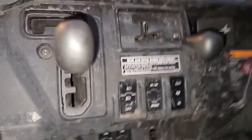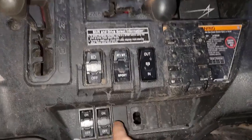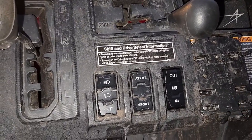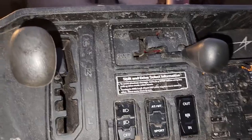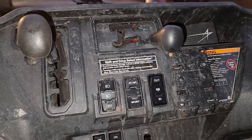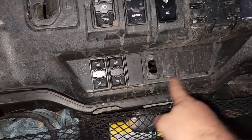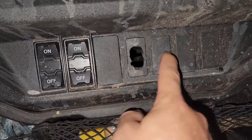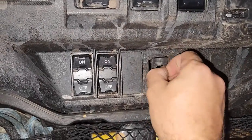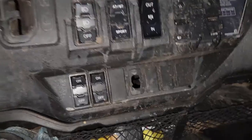Here's the finished product. I decided to put it up here where it's a little higher and easier to get to. This used to be a blank right there — just pop the blank out, pop the switch in, fit super easy. One nice thing about having it up high instead of down low is when you're reaching over the dash to hit the button to spool in your cable, it's a little easier to reach. Also it's easier to get to the wires. The old winch switch location needs a blank to cover it up.